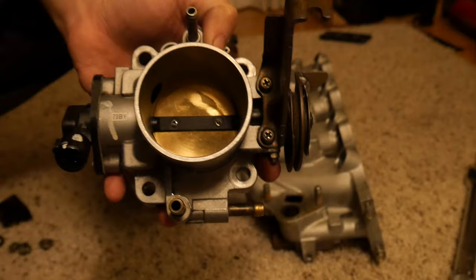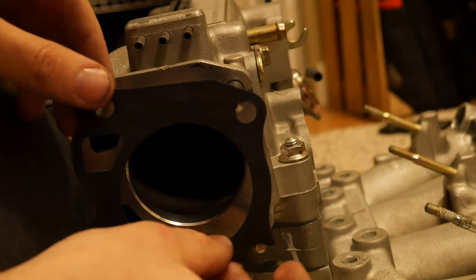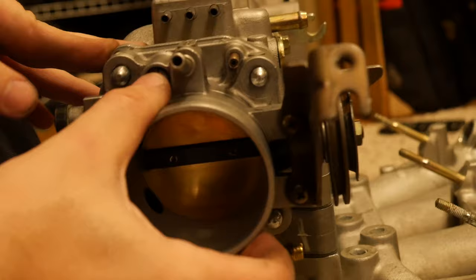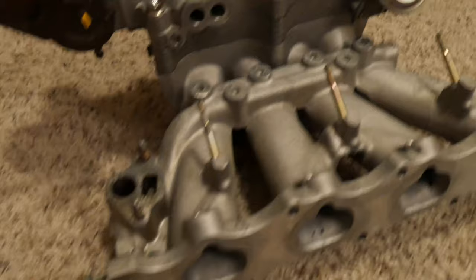Now I'm gonna toss in the intake throttle and that's pretty much it guys — everything's super clean, back up to spec, and pretty satisfying to be honest. Now that the intake is nice and clean, I can actually start taking things out of the engine to see the cams and springs and the actual wear and tear on a 300,000 mile engine. That's it for the intake. I'm gonna take the valve cover off next — that'll be the next episode. If you liked what you saw, like and subscribe, comment down below if you have any questions. This is Alex signing out.